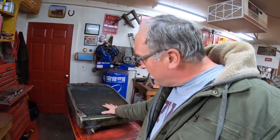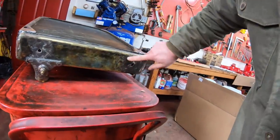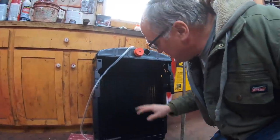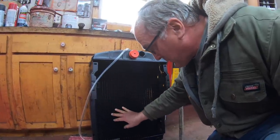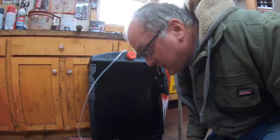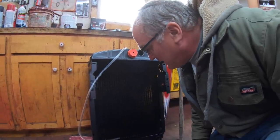I had to make a choice. I could have taken this to a radiator shop and had it re-cored, but adding to the problem with the core, it's been cobbled on the bottom — there's all this solder around the mounting bolt holes. Given both of those together, I figured I might as well get a new radiator. The new radiator is made by Northern Radiator, and they have a really good reputation for quality. There's a lot of junk out there with paper-thin copper — this is all copper, top and bottom tanks, copper cores. I was lucky: Northern doesn't sell direct, but there's a dealer in the next town over and they had it for me pretty much overnight.